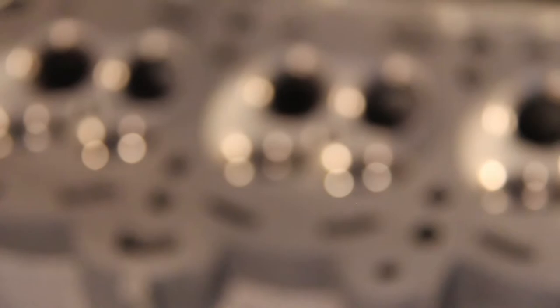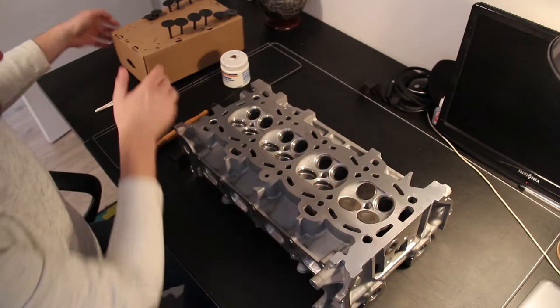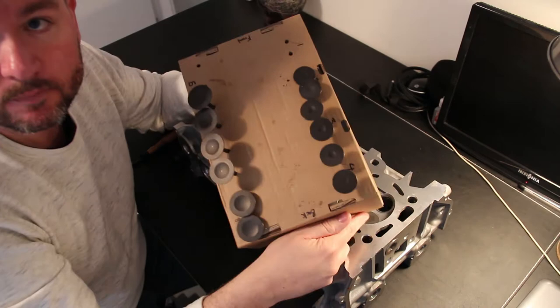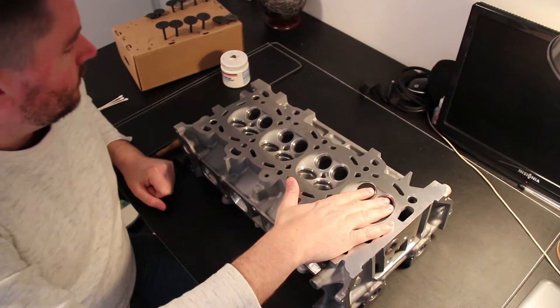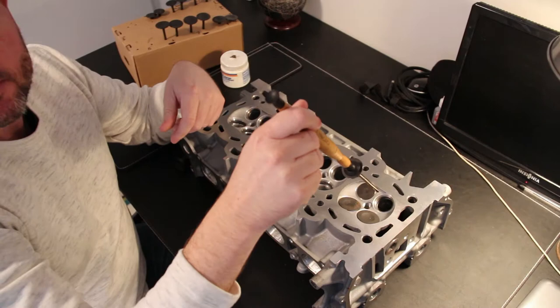That was my reasoning for pulling this apart again - this cylinder head - and I'm really going at it properly. I'm now at my desk with the cylinder head turned over. When I did strip this apart I arranged the valves front to back of the cylinder head with valves in their sequence, just because I wanted them to go back into the head the same way that I pulled them apart. So we're going to start going through the lapping of these valves. I do have suction cups which will help with the lapping as we put them into each of the seats.